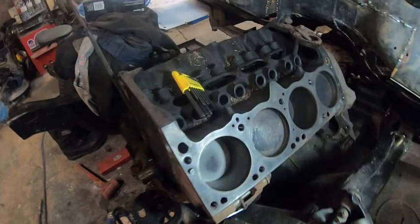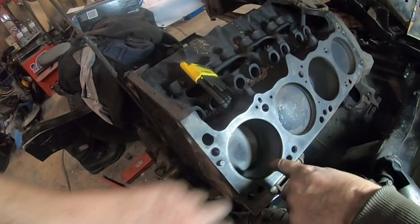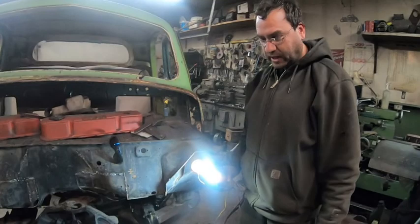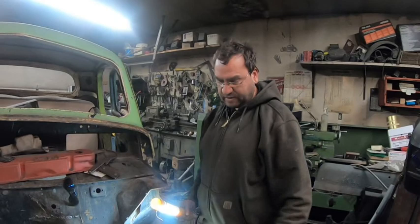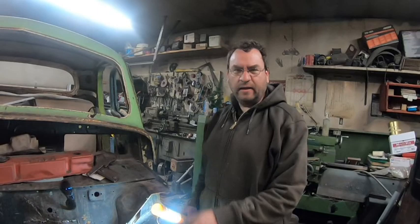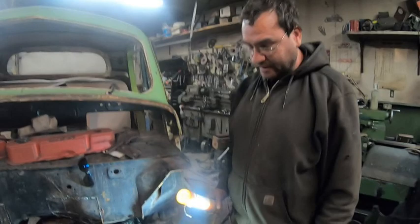Before we do that, we took the heads and the intake off the engine. Cylinders look good. There's one weird one - all the cylinders have a little bit of a ridge on them, not a whole lot, but this one has no ridge at all. We also found the spark plug was quite fouled on there, so it wasn't sparking. There's no ridge on this one. We thought maybe someone rebuilt the block - it has been apart - but if they sleeved that one cylinder... Derek miked it and it's basically factory bore, not like someone took a ridge reamer to it. It's more factory than all the others.